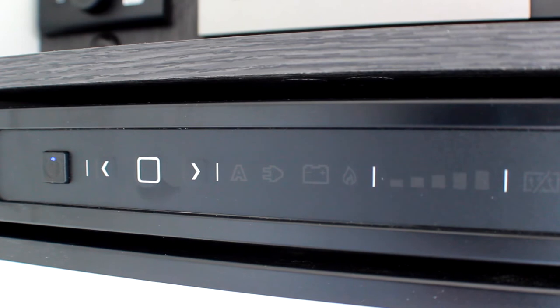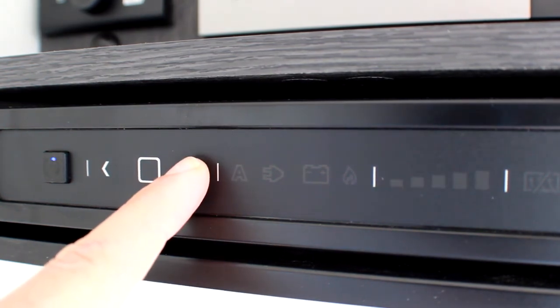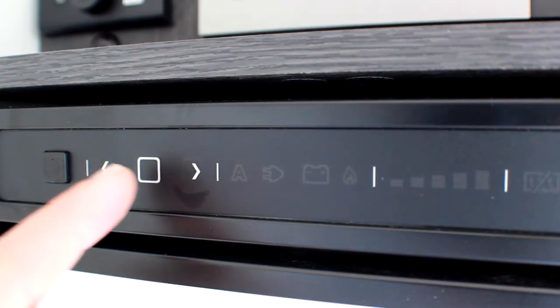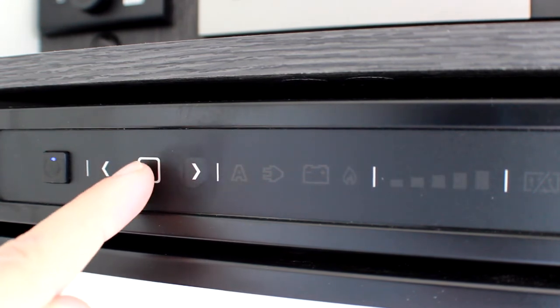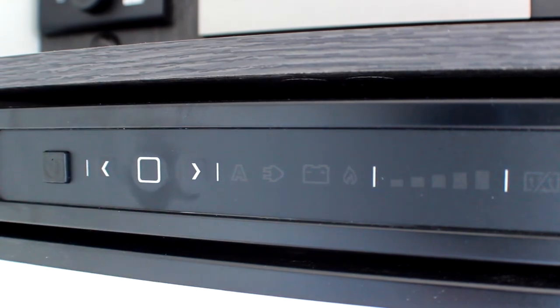Once you've confirmed your power source, you can now select the correct temperature. Again, using the arrow buttons and pressing the black button to confirm. A stands for automatic and will automatically select the best power source available. Once either the electric or gas power source has been selected, it will take about 3 to 4 hours for the fridge to get down to temperature.